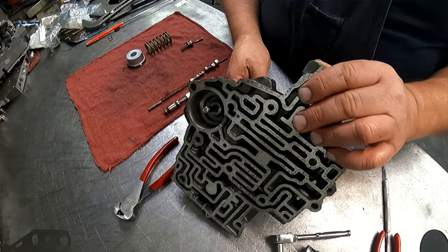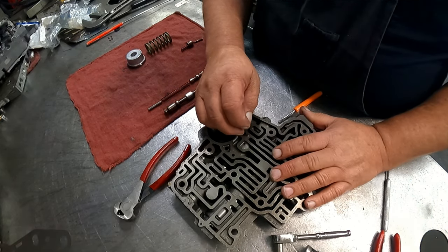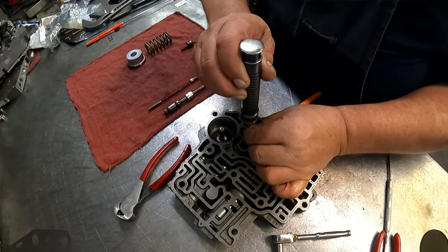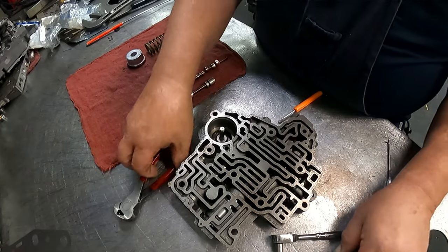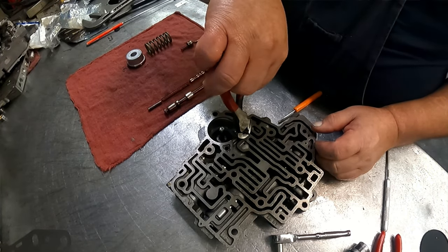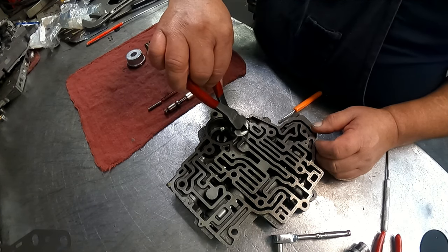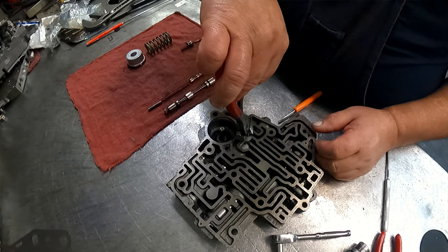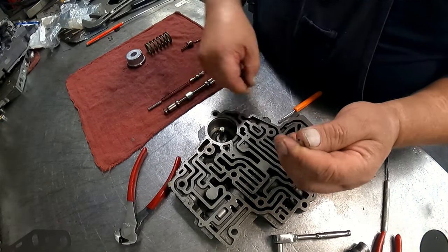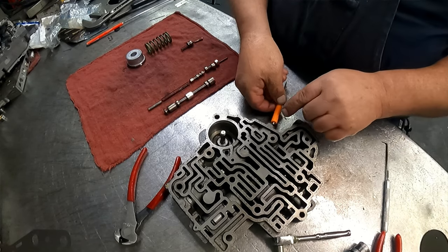Okay, I guess I should have shown where the roll pin goes. Anyway, drive this in there just enough. And then I get the end cutters on here. Don't go so much that you break it off. Use it as a heel bar and pull it up to where you can get to it, and then you can get it out usually fairly easily.